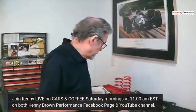when it gets down to that point, you and I will have a conversation on exactly how you're going to use the car, what tires you have, what your driving experience is, all those things. And then I'll figure a spring rate. If I had to guess off the top of my head right now, maybe 450 in the front. But like I say, the nice thing about coilovers, you can change them out. It's really easy. And I keep talking about all the pieces. I'm going to show you the individual pieces.